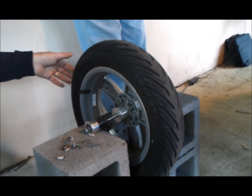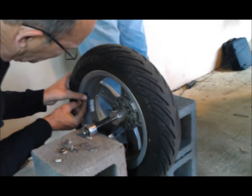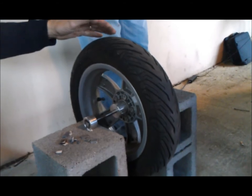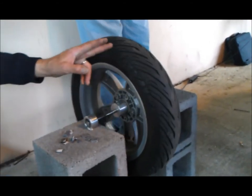And that's still not enough weight. Wow. Those are the ones that came off mine. The weights? Yeah, those weights came off my left tire. That's still not enough weight. But you have it in a slightly different spot, don't you? Yes. A slightly different spot, because that is the true light spot.